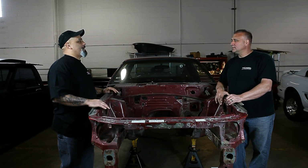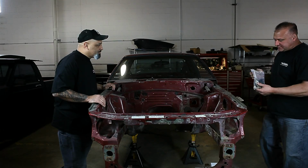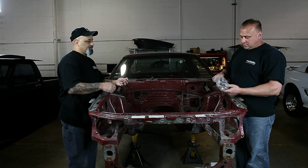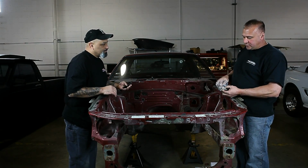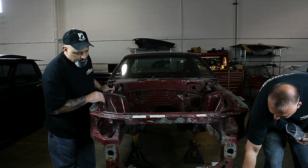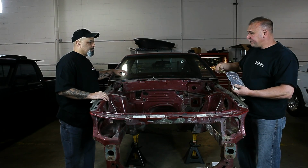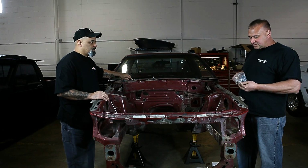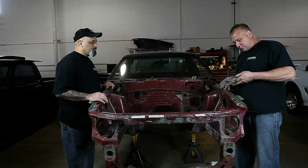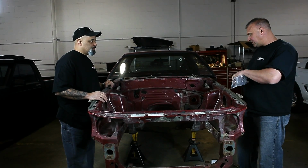Okay, so then what's our next step? Next step would be to get all the hardware out and together. We have this handy little hardware kit that comes with it. There are 4 14 millimeter by 100 millimeter bolts for the frame rails. These attach these plates to the bottom of the frame rail. Then we have 4 5/8 grade 8 A-arm bolts for the A-arms, and of course we've got the nuts, and we've got the hardware for the back plates on the frame rail also.